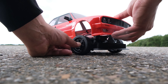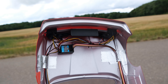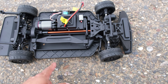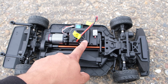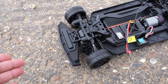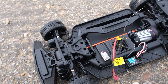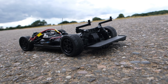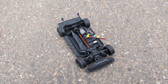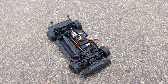So let's take a closer look under the body — you kind of have to push forward to release it. Doesn't this body look cool? Under here we have our LED light controller. This thing is covered in LED lights — I really like that. It doesn't look like there are any major changes on this version compared to the other one I've tested, maybe a slight change with the ESC cover, but apart from that pretty sure it's exactly the same. This does have your usual features: oil-filled adjustable shocks, metal CVDs at the front, metal dog bones on the rear, a metal centre drive shaft. There is a lot of plastic on this car, but we also have a plastic rear diffuser, metal differentials, metal gears, and ball bearings throughout. I just want to see this thing running, so let's get a battery in it, fire it up and see how it performs.